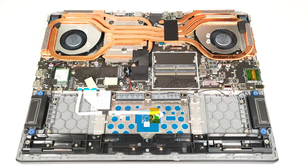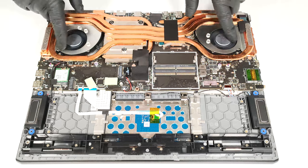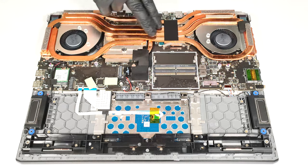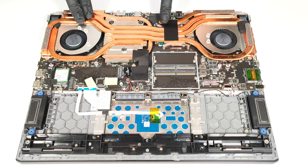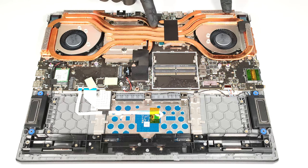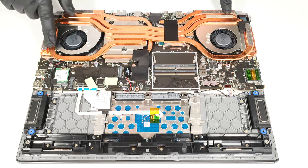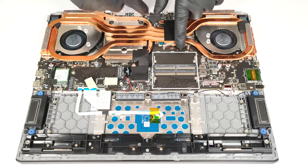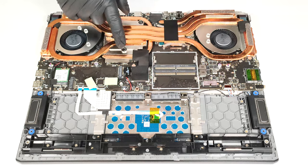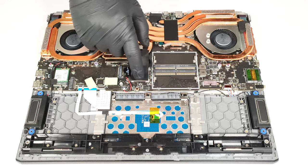As always, the Cooler Boost 5 thermal system looks massive. It boasts two fans and three thick heat pipes shared between the CPU and the GPU. There is also one extra heat pipe for the processor, as well as two more for the graphics cards, VRMs, and memory modules. We can also spot four sizable heat sinks, a heat spreader for the CPU, and a huge metal plate for the video card. The lower heat pipe and the chipset are connected via foil.